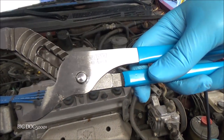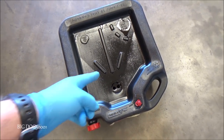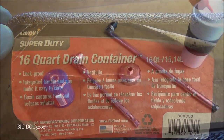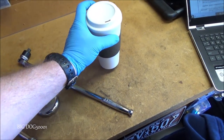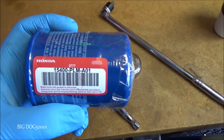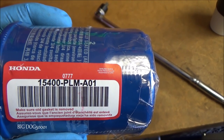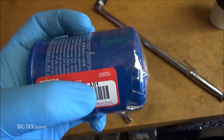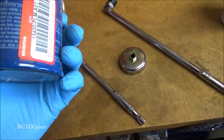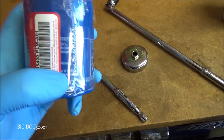You're going to need some kind of oil drain pan — that's the one I'm going to use. Here are the items we're going to need. I need some coffee, and we'll need a Honda filter. I suppose you can use an aftermarket too, but I only use Honda's. This is what I use: 15400-PLM-A01. They also make the A02, just two different manufacturers — this one's made by Filtech or Wix.